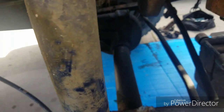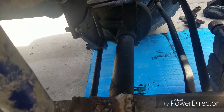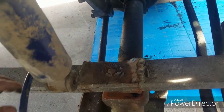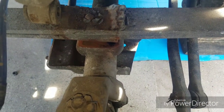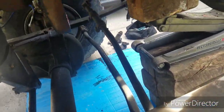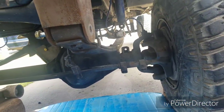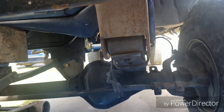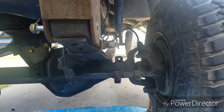I'm doing this job by myself, so there are a bunch of different things I have to do differently than two people coming in to do it. I put my drop bracket on and attached the sway bar link because the front axle is going to want to rotate. I undid both sides, took the bolt out almost all the way, and now I'm going to lift the truck so the leaf springs move away from the axles by lifting the front.